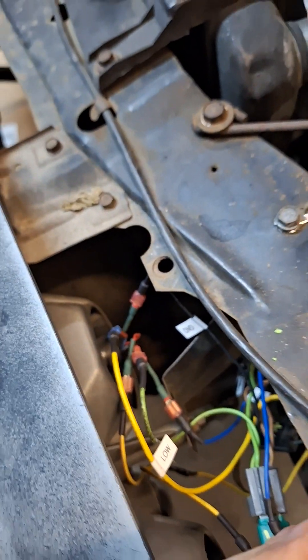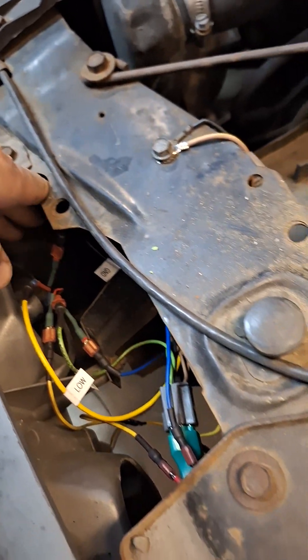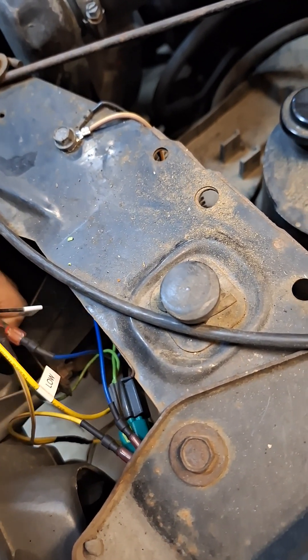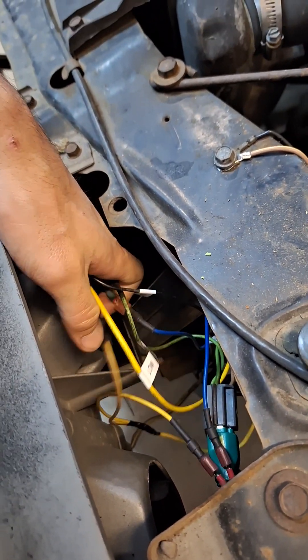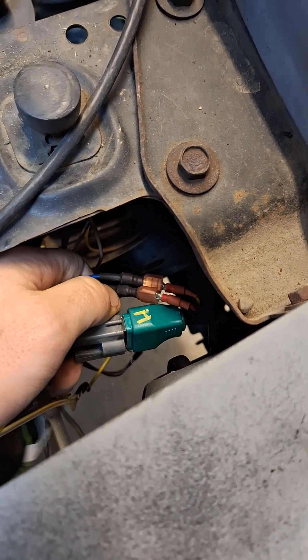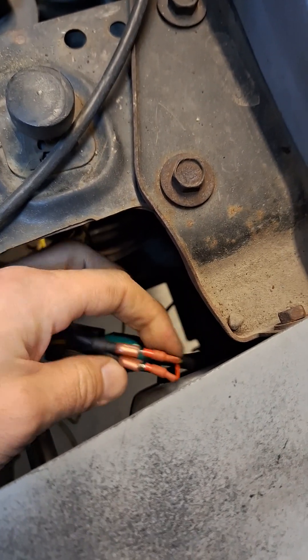So I'm running basically five wires per light. On the original high beam position it's all five spade connectors because I chopped off the plug. On the standard low beam it's one three-prong plug that was depinned and repinned, plus two spade connectors.